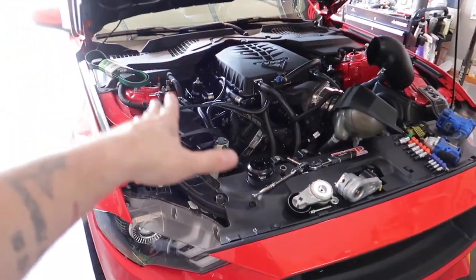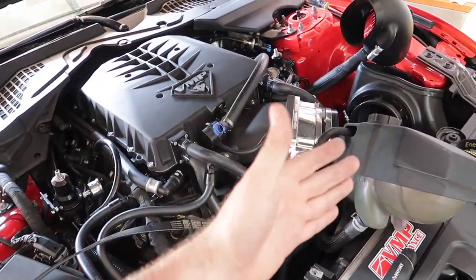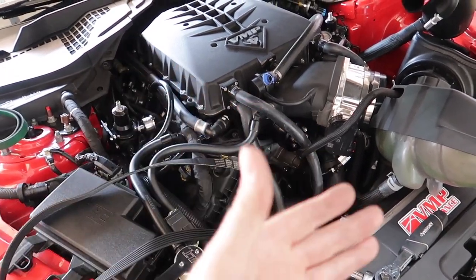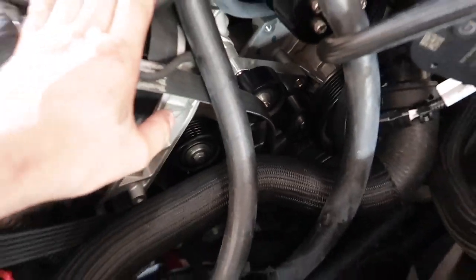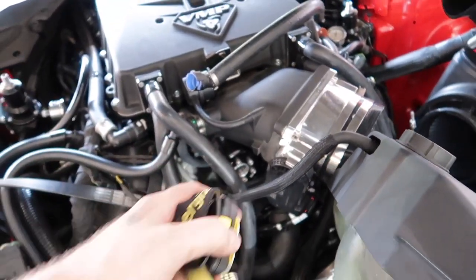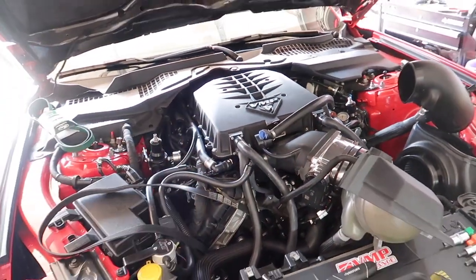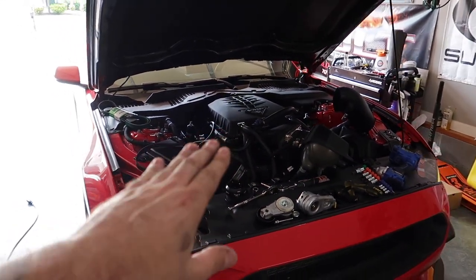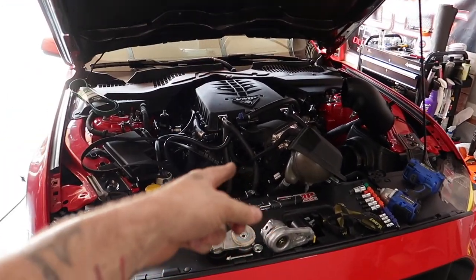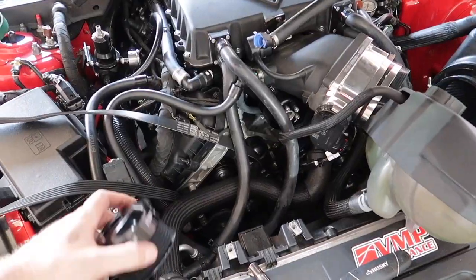This is the first time I'm ever doing a belt change and pulley swap on this car with this blower. Some blowers out there have the supercharger belt on the outside of the balancer, but this one is towards the back, which has its pros — it's less far away on the crank, which is good. That back portion is actually what drives the supercharger. The 88 is good for about 12 to 13 pounds of boost, and that is rated on a stock engine configuration — stock exhaust. When you start to add things like headers and free-flowing exhaust, you typically lose PSI. So where that might be a 13 PSI pulley, we might actually have like 11.5 to 12. Nothing bad — you're still gaining power, just a little bit less boost.